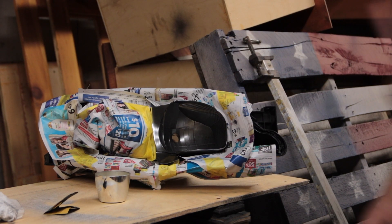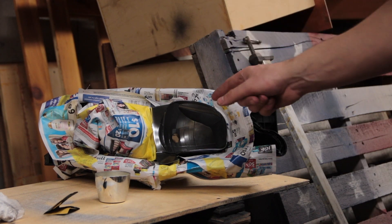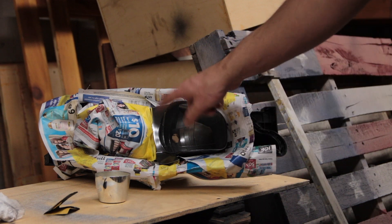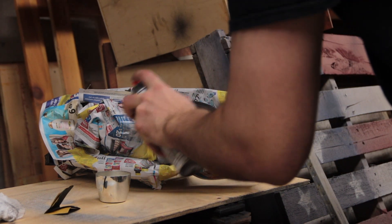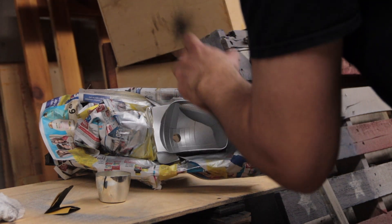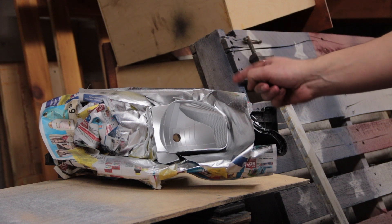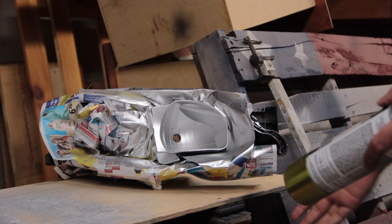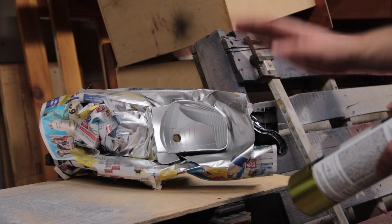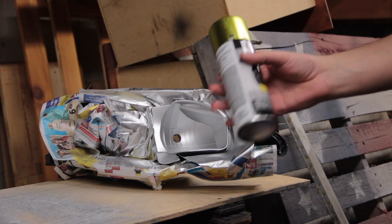These have been scuffed now with soap and water. You really want to make sure it's dry — even if you dry it with a towel, there are little grooves, so just make sure you have time for it to dry. Both the blinker housing, the daytime running lights, and the bright light housings have been done. The product says let it dry 15 minutes, and recoat anytime, which tells me it dries really fast. I'll put two or three coats max on there.